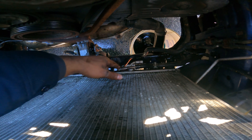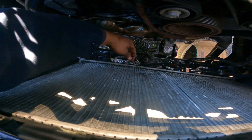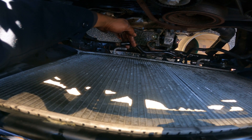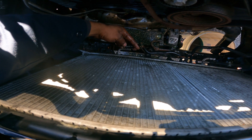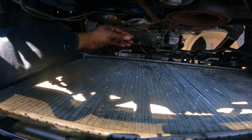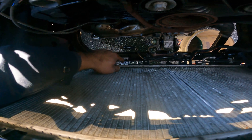For this transmission cooler line, I didn't have another bolt so I used a socket to stop it. For the far one, squeeze the clamps and slide them down the lines. Once you start bending the lines with clamps, spray a rust penetrant like PB Blaster or WD-40 into the part where the hose starts to open up a little bit — that'll make the surface slippery so you can twist the hose and pull it off.